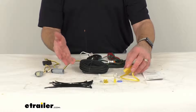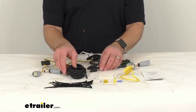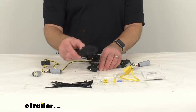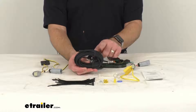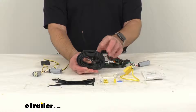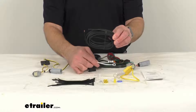Your wiring in your Trailblazer is going to be protected. You can secure any excess or slack in your wiring with the included cable ties, and there are plenty that come in this kit. When you are routing your wire from the rear of your vehicle to the front, just make sure that you are staying away from any moving parts or anything that can get hot, so as not to damage the wire running to your battery.